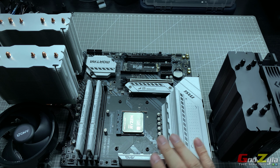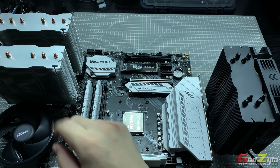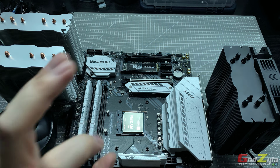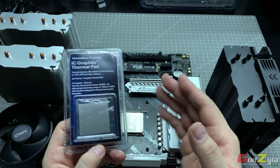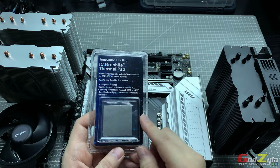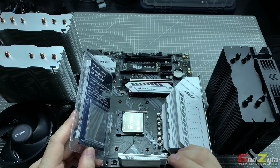Ballistic. Now, to be fair and square, I know that applying thermal paste with the different heatsinks like the Tranquillo, the Glacier from Gelid, against this default AMD heatsink, could differ. So as mentioned, I'm not going to use thermal paste. Instead, I'll be using this. This is in fact a thermal pad that is specialized to use on heatsinks for tests and benchmarks. It can be reapplied again and again. So I'll be applying this to have a fair comparison, so that it doesn't say that I applied too much or too little thermal paste that will affect the test itself.